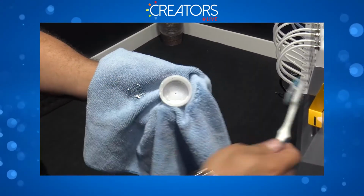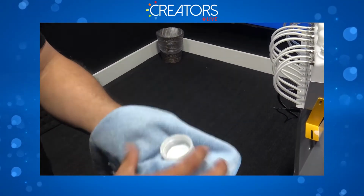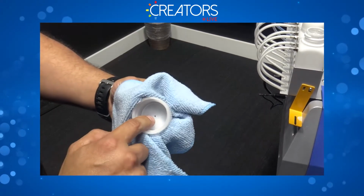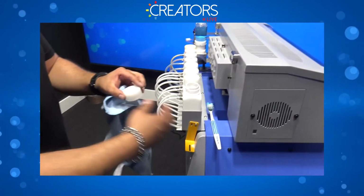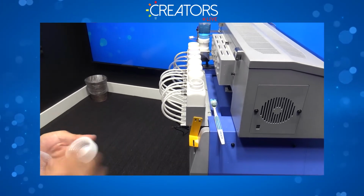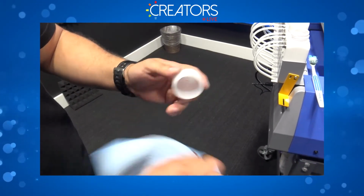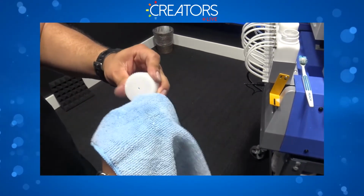You definitely don't want dry ink on your lid, neither on your thread on the bottom. So once you're done with that, you can use your microfiber rag and dry it. And you also want to make sure that the hole in the middle of the lid is free of ink. This is pretty much what helps the ink to flow through your print head. So make sure your hole is never clogged or covered with ink. So do this. There you go. This thing right here, what I also like to do is wipe it off so I can have a nice clean lid.